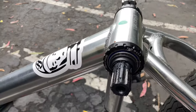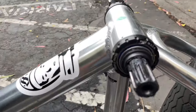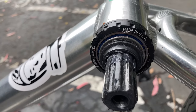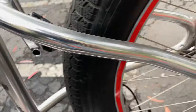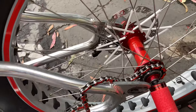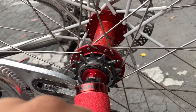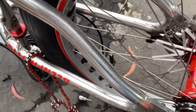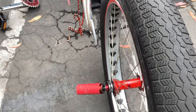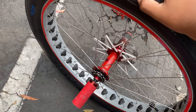Now we have the crank arm and sprocket off. I just pulled it off — I have the profile bottom bracket, I'm going to have to clean that up soon — but pulled it off and the chain came off. So now that the chain is off, I can pull it down and leave it hanging, and now I can take the wheel off and work on that disc.